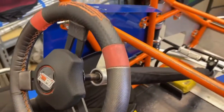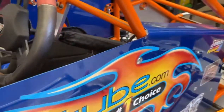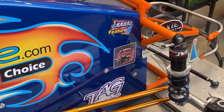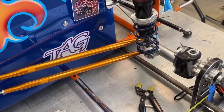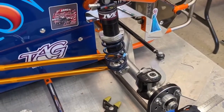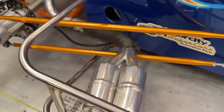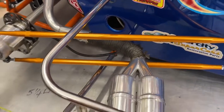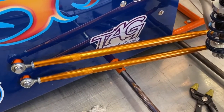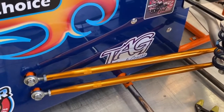The steering wheels have these orange marks on them. You either have to watch your driver or put a zip tie or an orange piece of tape on the steering wheel and watch him as he goes around to see how much his hands are moving or how smooth his line is. Then you can adjust the lead. This is one of my favorite adjustments to make because it really fine tunes the car and then you're going in a perfect circle. You can adjust the lead in and out by these radius rods. We never touch the rear radius rods after we square up the axle - we always adjust it from the front side to get our lead honed in. We like to run about three quarters to one inch on these cars.